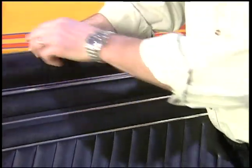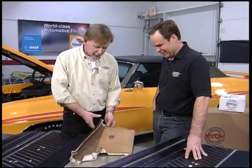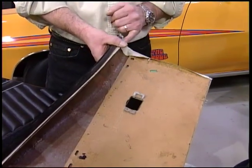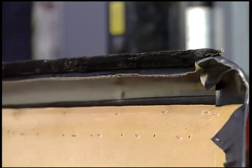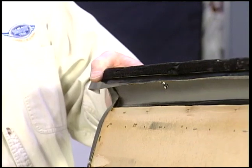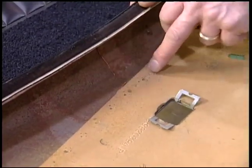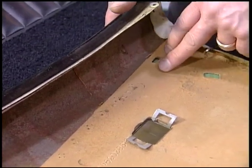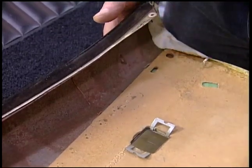I'm always wondering how you attach this cardboard to the steel panel. Basically, taking this panel apart, we would very carefully measure for the height from the top of the radius to the panel — it has to be bang on, or else you're going to get gapping in the top and bottom, and that'll cause the holes to be misaligned and cause big problems. Basically, we would locate it, drill right through, peen rivets onto it, and then machine the rivets down so they're flush mounting so they don't interfere with mounting the panel.